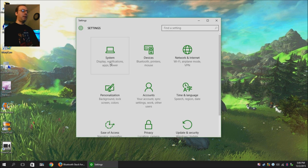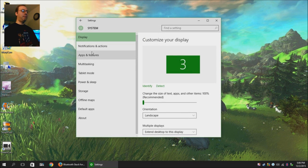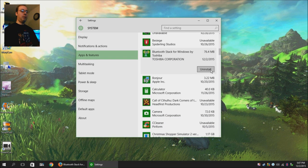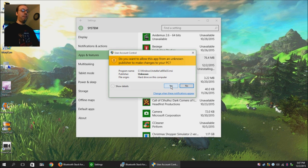You might also want to double-check in your Add/Remove Programs. If you're on Windows 10, it'll be in Settings under System, Apps and Features. For previous versions of Windows, you'll need to go to the Add/Remove Programs Control Panel. Since I was already using the Toshiba drivers, I know that there is an actual application here, so I'm going to scroll down and uninstall.